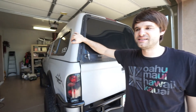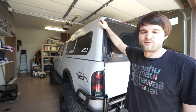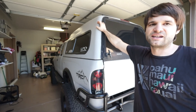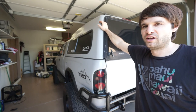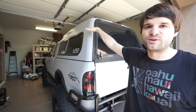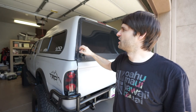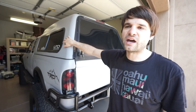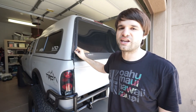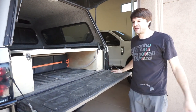Now let's look at the truck bed. We have a high-rise canopy that sits just over 7 feet high — with an 8-foot garage door it will clear, but a 7-foot door it probably won't. The cab height without the canopy is 6 feet 6 inches, so without it you'd fit anywhere. Inside we have a sleeping platform with a spray-and-roll style bed liner in the truck bed. The high-rise canopy gives you just under 27 inches of headroom at the front, even with this taller platform.